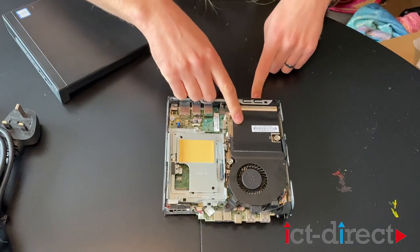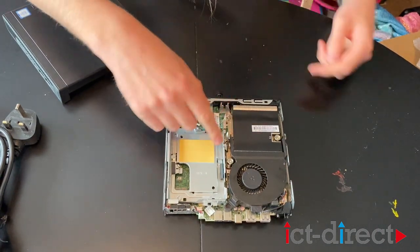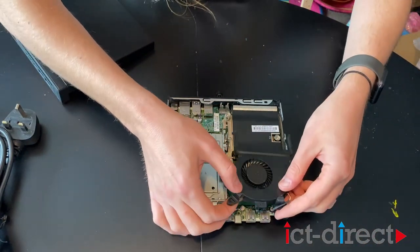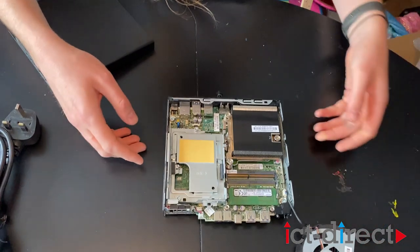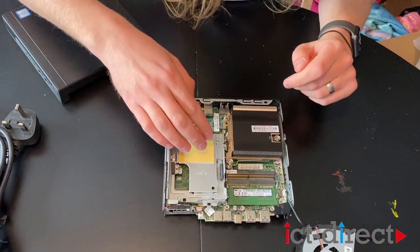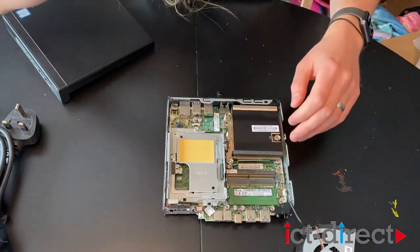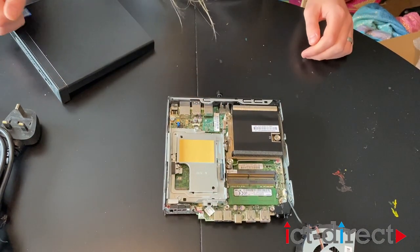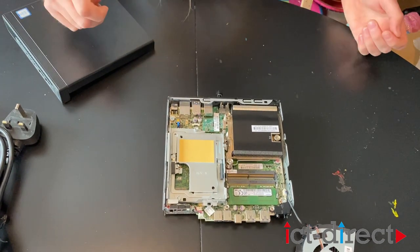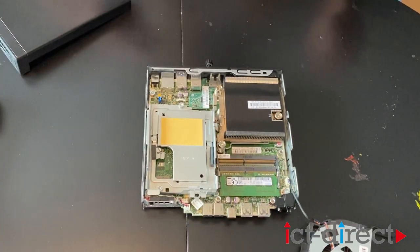The 6500T, as I've mentioned previously, is a 2.5GHz quad-core CPU. Underneath the fan, we've got our space for two SO-DIMMs, and currently we have got 2133MHz DDR4 8GB. It will take up to 32GB if you want to put a pair of 16GB in, so that makes things nice and flexible. But we'll sell this with 8GB as standard.